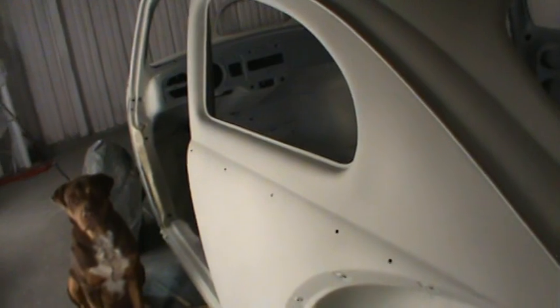Anyway, that's where we're at with that. Getting ready to scuff that down, put some seam sealer down, some two-part self-leveling, and I'll probably have to use some heavy body too on those seams in the engine compartment. I think I'm gonna get in here and sand some of the seam sealer down like I did up front — knock some of the edges down that didn't lay exactly like I wanted. So yeah, we're getting a little closer every day.